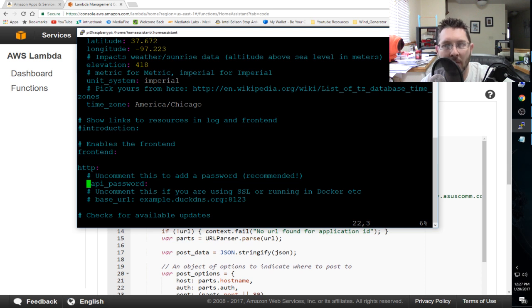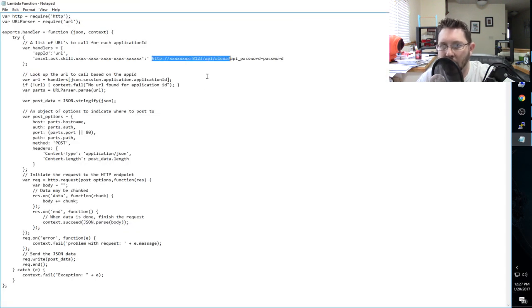Like, mine was, you can have like 54 dot something or other. It'll be a weird address. And so it translates it to that. So if you typed in here your 192 address, it's not going to work. It's not going to work. That's on the inside of your network. You need the outside address, or the one that your ISP gives you. So you can type that in here.